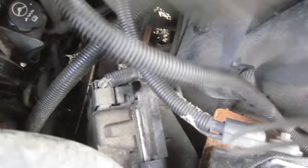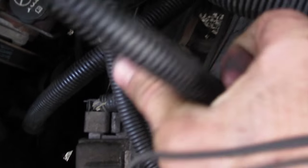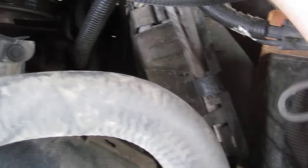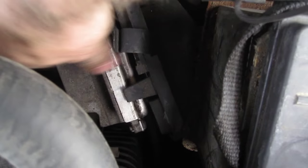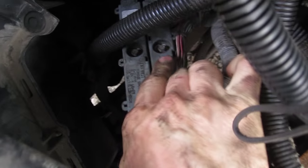We pull this cover off with these little tabs — one right here and one right here — off of these little knobs. Then there's a steel clip here, pull that back, and then this one little tab, just lift up on that. There you have your ECU in your hands. Seven millimeter bolt — take those two bolts out and your ECU is out.